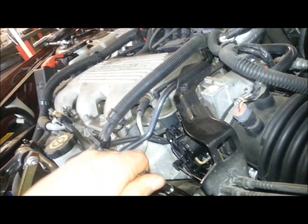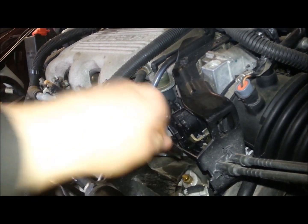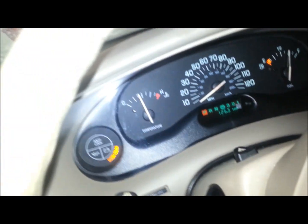Crack that bleeder again, make sure there's no air. Coolant's right where it's supposed to be — we've got great heat and no leaks. I'd say our cooling system has bled. Just keep checking your level, make sure you're tightening your cap down, and wait for this coolant to burn off. Make sure your bleeder cap is tightened. Do not touch the radiator cap — that one will cause you a very bad day. Thanks for watching Joe the Auto Guy.